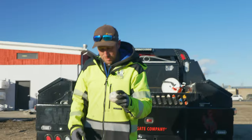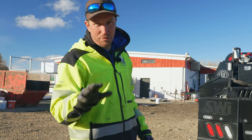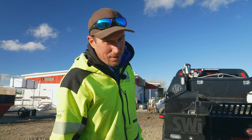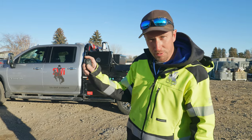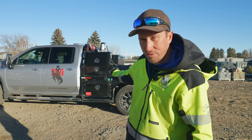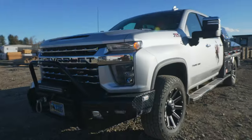It's always good to carry a baseball with you or some sort of ball — that way if you get stuck on the road, you have something to do. We equip all of our trucks with hazard lights because if we're working near a road it's always best to let people know we're there, and some of our commercial jobs require them, such as airports. The lights came from STL, which is SpeedTech Lights. They're all surface mount except for the one on top of the cab, which is a magnetic mount. With this setup we got a switch box with a wireless remote — the switch box stays under the hood so you don't have to run any cords through the firewall of the pickup. Up top we have our magnetic mount, a surface mount here, four surface mounts on the back, and four surface mounts on the front.